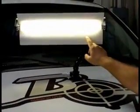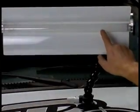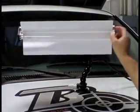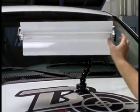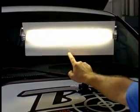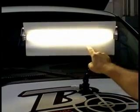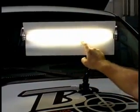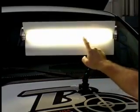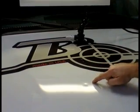First, with the light — I want to explain that this is a 12-volt shadow caster light. We do sell it on our eBay or on our website. As you can see, it's got the standard T12 bulb, it's 18 inches long, and this light actually creates its own dark line. It goes from bright to darker to darker until it goes off the metal. What you're using is the gradient part of the white to the dark, and that's how you're reading the dent.